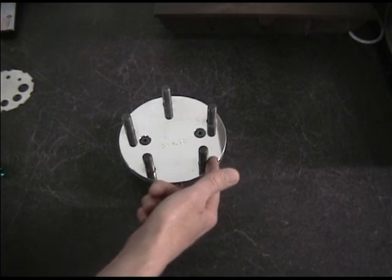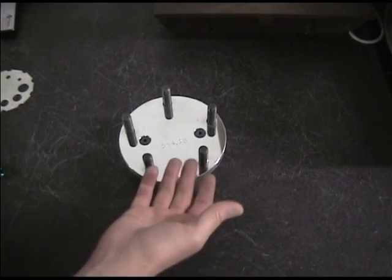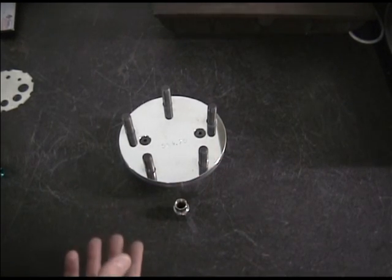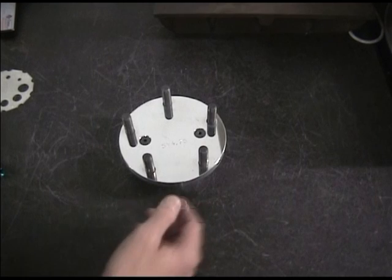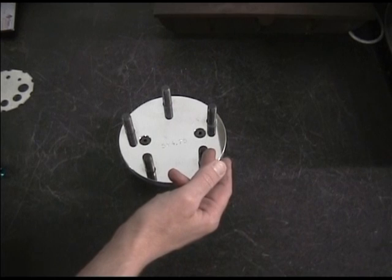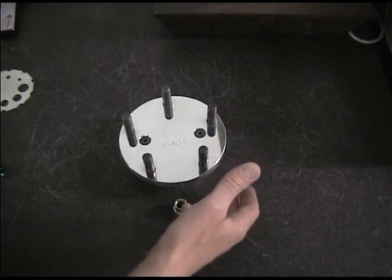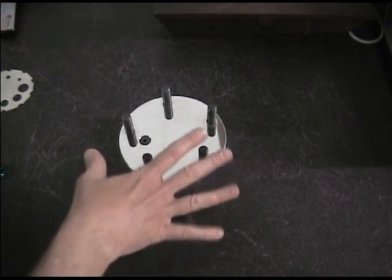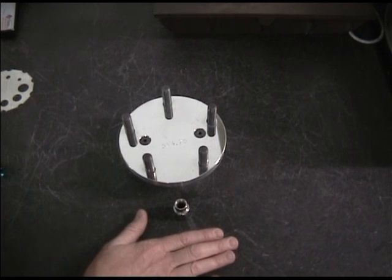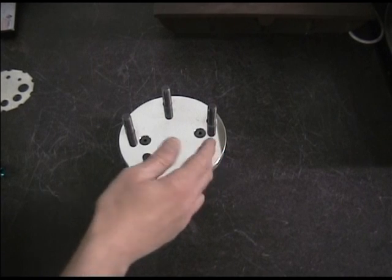The diameter of the stud and the pitch of the threads determines its clamping force and how many foot-pounds of torque it takes to reach that clamping force. Ideally, we want to slightly stretch the stud so that it acts like a spring — the steel is stretched and acts like a spring, holding the tension all the time regardless of temperature, throughout the operating cycle of the vehicle. So the amount of torque required is enough to stretch the stud, but not enough to break it.